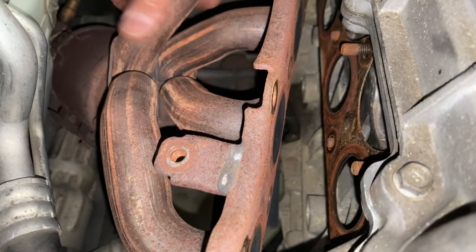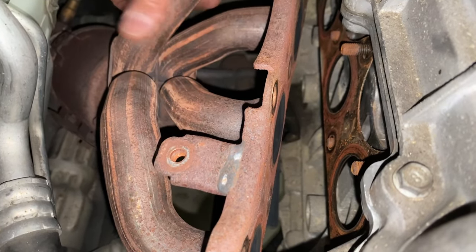Everything is running good. When you put a new catalytic converter on, you need to run it and let it kind of burn itself through. You'll get some smoke at the beginning — sometimes people get concerned with that, but that's normal. Just let it clear itself out, and once it heats up and goes through that, it'll clear out. That wraps up this video on how to replace the catalytic converter on a Kia Rio or any vehicle utilizing the 1.6 liter four-cylinder made by Hyundai. I hope this video was informative. Please send me any questions and comments — I would love to hear from you. Please like the video, subscribe to the channel. I'll see you next time.